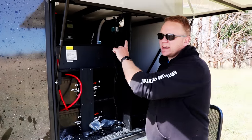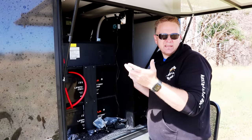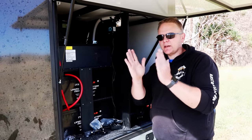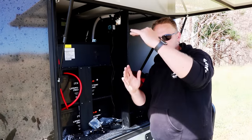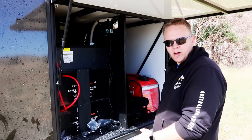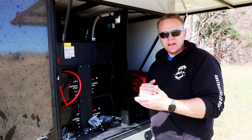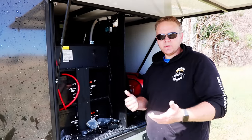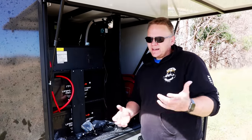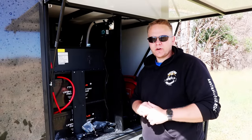So this is the Toppergy — it's actually a water tank level indicator showing percentage. You calibrate it for how many litres are in your tank and as water comes out, it counts the litres and gives you a percentage on your phone showing how many actual litres you've got left. Super handy with this sort of setup. I've got 110 litres — it's a fair bit of water, but if you're going away for 10 days, 110 litres isn't that much, so you're going to need to monitor how much you've got.